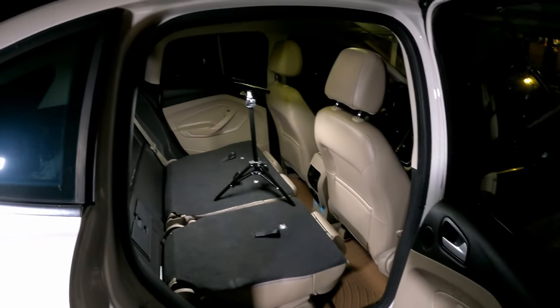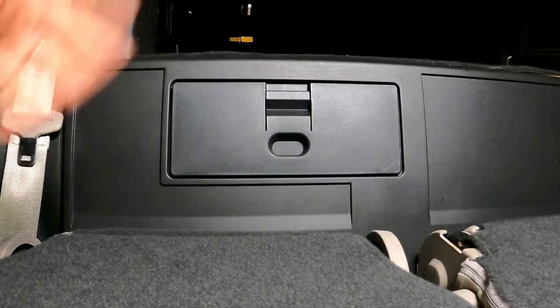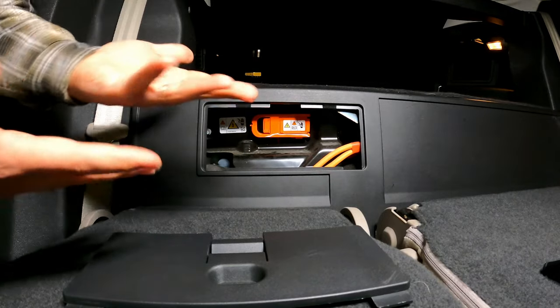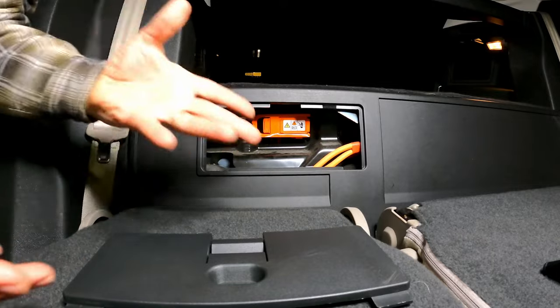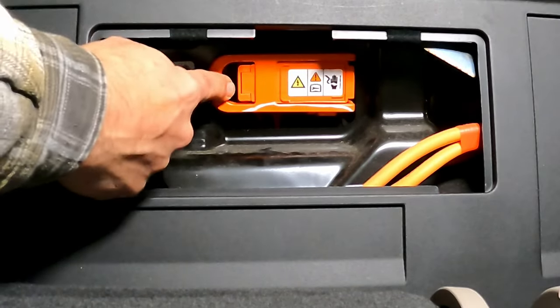To disable the high voltage battery, I've opened the doors so the car had a chance to turn on and then back off again — all screens are dead, not actively doing anything, so the high voltage battery is basically neutral. Behind the rear passenger side there's a little compartment — that is your high voltage disconnect. I'd suggest wearing some heavy gloves. I've already done this and I know this battery isn't damaged, but if you have any suspicion of damage or this is a salvage vehicle, approach with appropriate PPE, read the service manuals and all precautions. We're going to take this handle and slide it left.